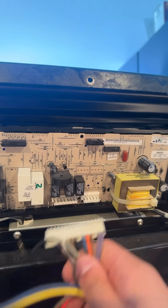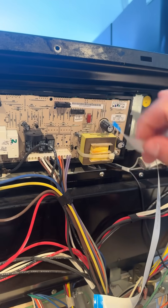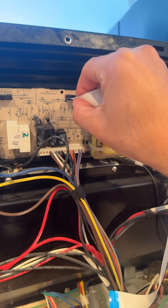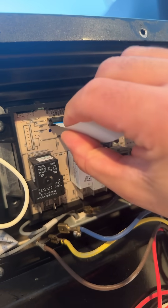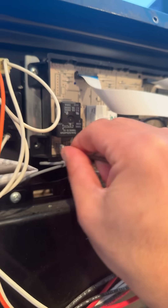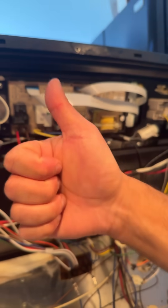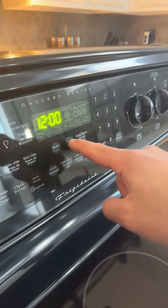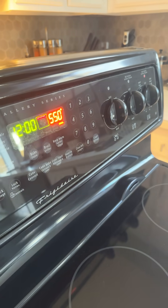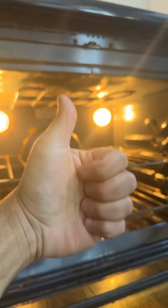Now let's retest and see if this works. Plug in your main wiring harness, then plug in the two very delicate ribbon cables for the LED LCD touch panel on the front, and then the power wires that bridge the signal so the bake elements can turn on. Once all wiring is in place, we're going to attempt to burn our hand once again — except this time we want to see the element turn red first. And just like that, bam — red, and red means hot. All we had to do was fix the solder, and boom, that's a wrap.